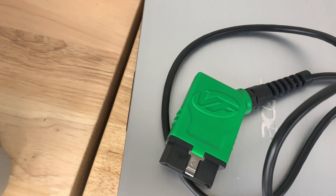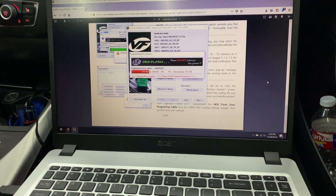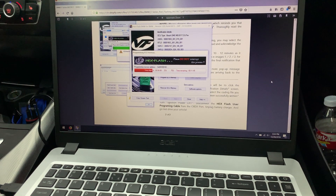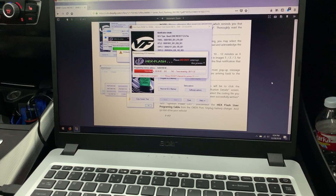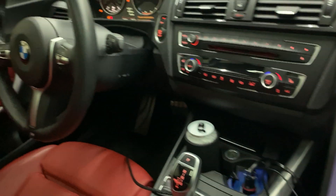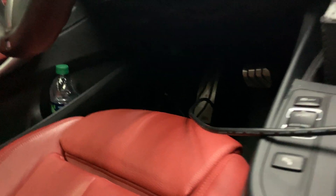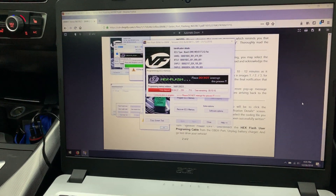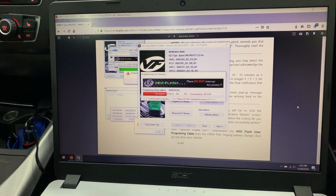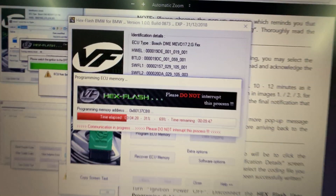Welcome back! This is the second episode of the Project M235 mini-series, so if you didn't already see the first episode, you should probably go watch that first. The tune I use is a VF Engineering hex tune. Since I'm doing dyno runs after every mod, I paid for stage 2, but then asked them to also send me the file for the stage 1 tune, and they obliged. So I flashed the car stage 1, and the difference was immediate — it's the single biggest butt dyno gain I've ever felt from any mod on any car that I've owned, and I've owned a lot. So the dyno graph should be really telling.